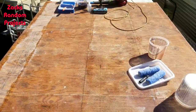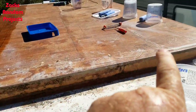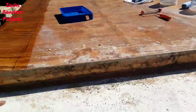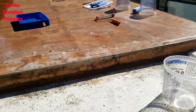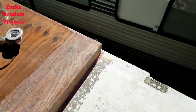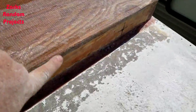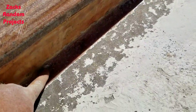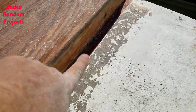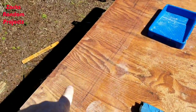Alright, we got that strip done. With a little proper planning I would have sanded this out already and gone straight to fiberglassing that strip, but I didn't think that far ahead today. So I'm about to sand all this and get it ready for the strip going the other way. Got it sanded - from where the roll left off, going from front to back, around the back corner, down the face, across the peanut butter putty I made, and out onto the back deck a little bit. That area is all gonna be continuous fiberglass.